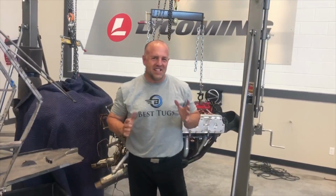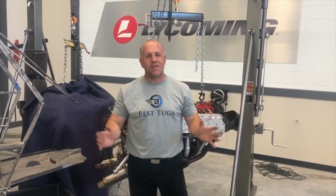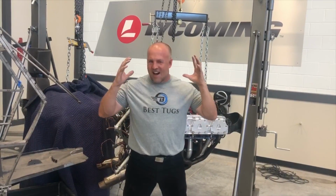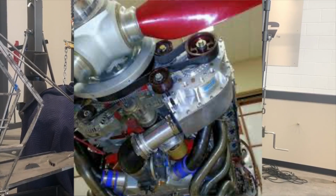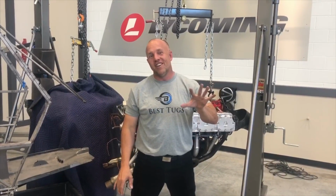So not only is this engine 500 horsepower, it sleeps at 500 horsepower. This is not wound up, crazy RPM, wrapped out, boosted, turbocharged, or nitrous. This is all about displacement. This is cubic inches, high compression on a built motor. This plane once, when I was racing it, I had it supercharged. I built a complete supercharger system for it. This engine's capable of 700-800 horsepower, and we're running it asleep at a mere 500. So it's perfect for a plane called Scrappy.